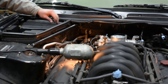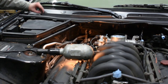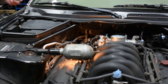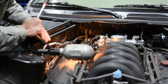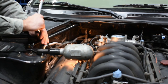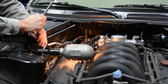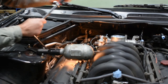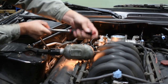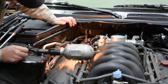Probably not the greatest place I put that nut the first time. Unless your drain filter is knocked out, that big of a nut won't fall anywhere — it's a nice little cubby hole. I'll keep a dish nearby. To make this a little easier on the back, I'm going to add an extra extension. Now that they've been broke loose, go ahead and spin them out. You can do this to break them loose, but remember every inch of extension you add gives that much more springiness. When you're trying to break it loose, it's a lot easier on a shorter extension.